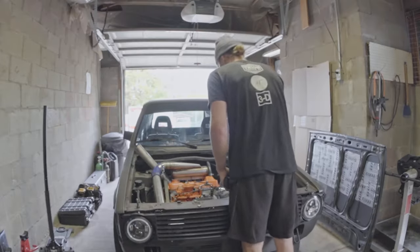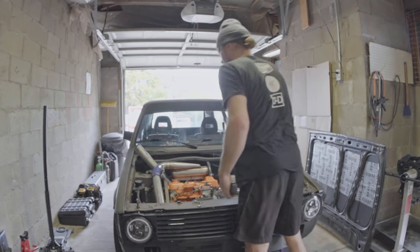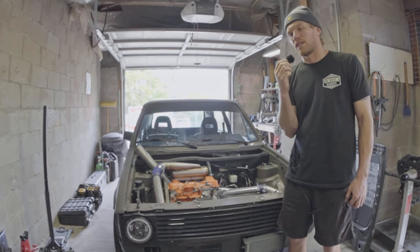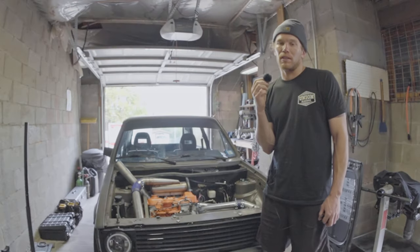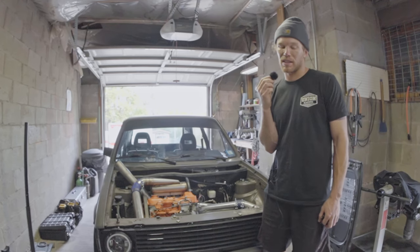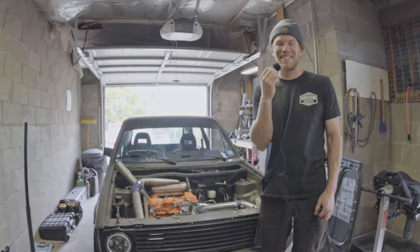And then the other thing, of course, is that my actuator keeps falling off of the turbo vane lever, which is not helpful, so I just lose control of the vanes purely because I haven't found a clip that works very well on it yet. Get a little clip, a spring, something, literally anything to hold it on there. You're supposed to use a circlip, but it's hard to find the right size. So at any rate, doesn't look like anything else blew up today, so that's good.